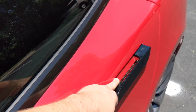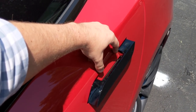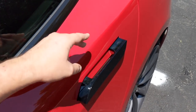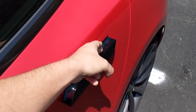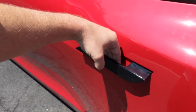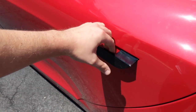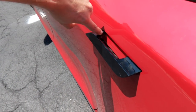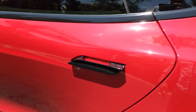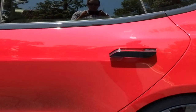You'll be left with a piece of vinyl covering this curve. Trim it about a half inch from the curve, cut out the excess in the middle, heat it up and roll it over the edge. I actually took that piece of vinyl I cut out and inlaid it on the inside so it's nice and smooth — you can't feel where the different vinyls are. The inside is covered as well. It will leave a little bit of chrome showing there, but if you walk up to the car you don't see any chrome at all. Totally good enough for me.